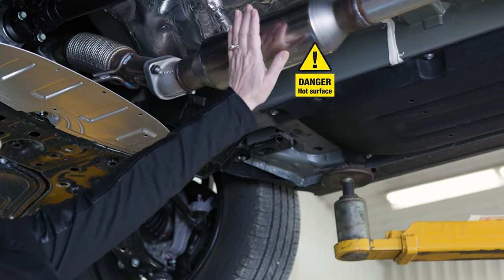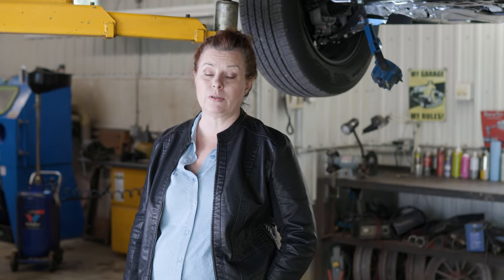Here's a great safety tip. Catalytic converters can be extremely hot. Check carefully that your catalytic converter is cool enough for you to work around safely. If it's too hot, just give it time to cool down. If you are a professional using the proper safety equipment, you can cool down the catalytic converter using compressed air or clean water.